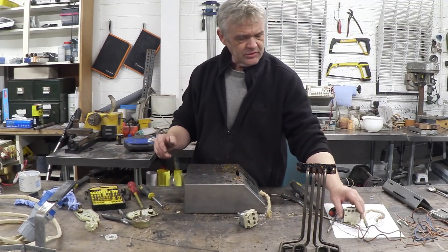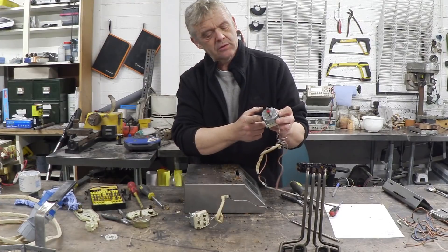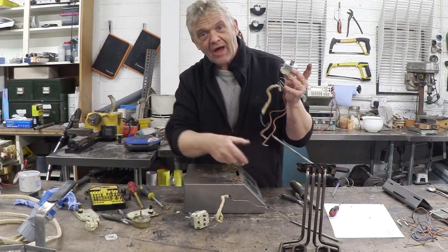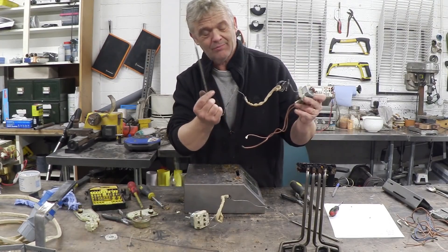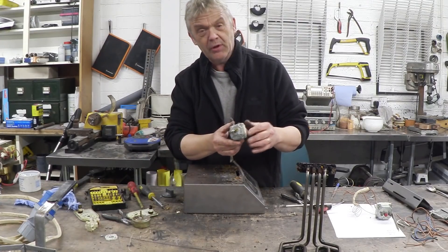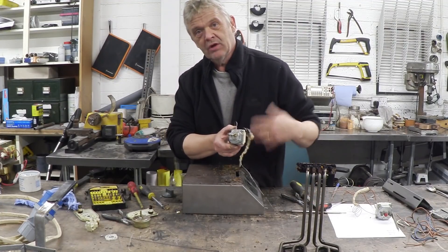When we take these bits apart we can see what was the core electronics within the actual fryer. There is the thermocouple right there leading to this bit, which has no controls on it but a big red button - that's clearly the emergency cutoff. This will be set to some temperature where it would cut off once that excess temperature was met. Then this was the main bit connected to the control knob - a bimetallic strip thermocouple of some description, and there is the sensor probe that went into the fat, the one you twiddle up and down to give a different temperature.